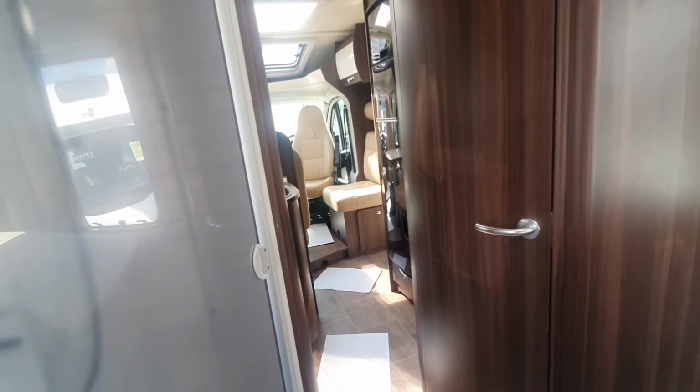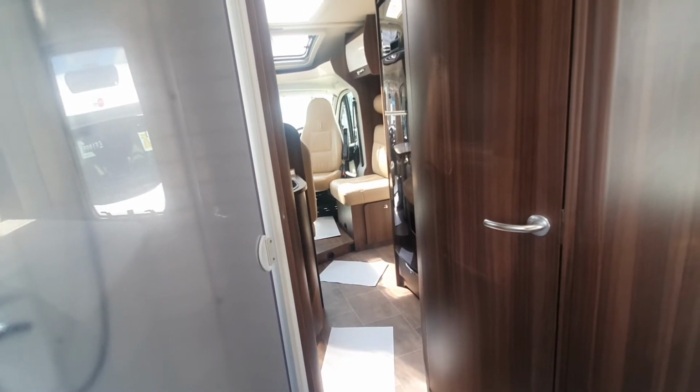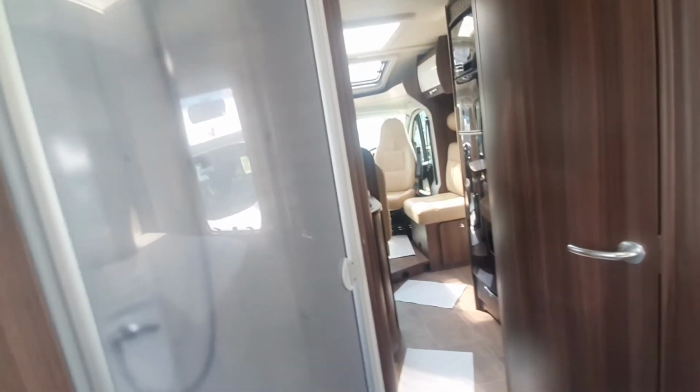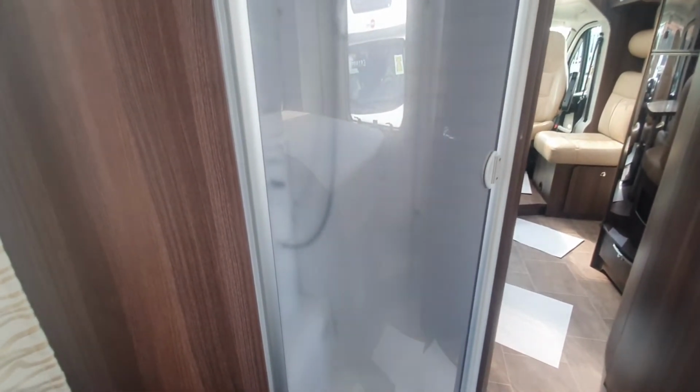The water will then splutter. Once it runs smooth, we know that we've pressurised our system, and only then can we turn our hot water on, because we want to make sure that we've got water in the boiler before we turn it on. And again, if you don't have any water in that boiler, say the frost protection valve has dropped, or you just don't have any in, you can use it just on the heating setting only.